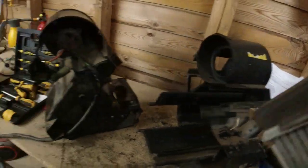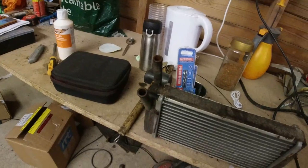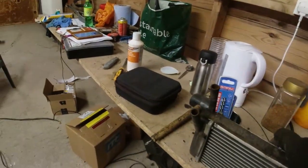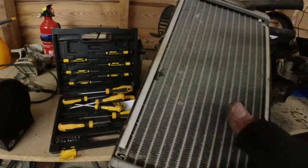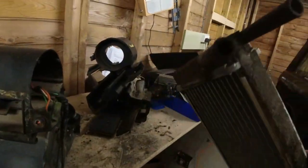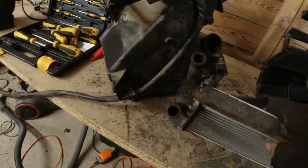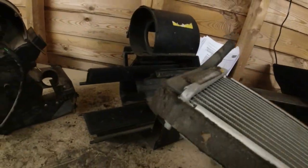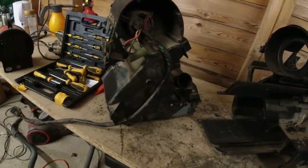The matrix looks okay, but because the thing had no antifreeze in it whatsoever, I will check the flow-through before I put it all back together again. I've heard that full fat cola does marvellous things for cleaning these through. It's got a fair amount of weight to it — it wouldn't surprise me if it is actually full of sludge. I've had problems with the replacement version of this where the plastic header tanks and the aluminium frame blow out along here because it just hadn't been clamped tightly enough. I was on the motorway when mine gave up — just filled the car with steam. Not very helpful. I'll get the motor out and do a diagnosis on that.